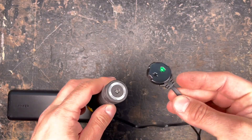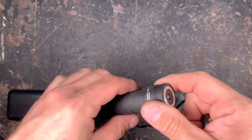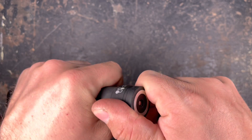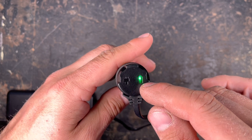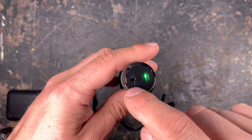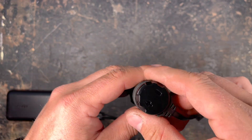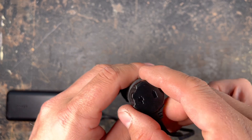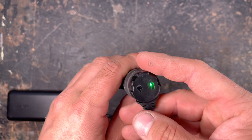While I go over the technical details, I want to show you the charging. You need to pay attention: if the flashlight is completely closed and working when you connect the charger, the red LED will blink — this means you need to loosen the tail cap a quarter turn. Then the green indicator blinks while it checks the voltage. The red light will be solid red until the battery is charged, then switch to green. If there's a problem with your power bank or charger, the light will show orange, indicating you need to clean the contacts or that your power bank isn't delivering enough current.